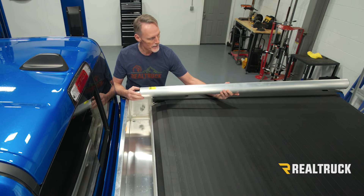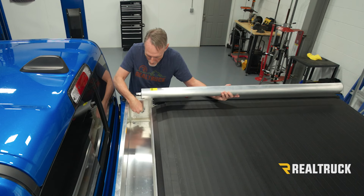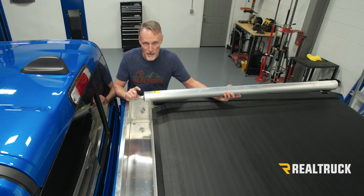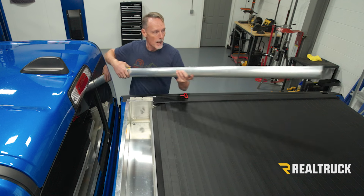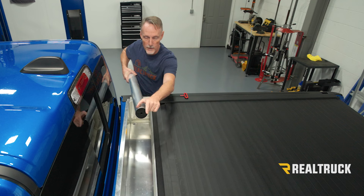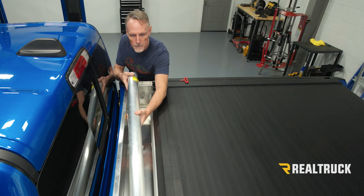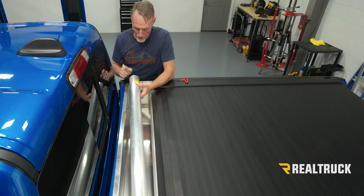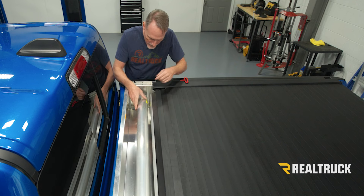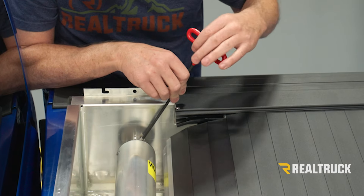Now here's our new spring reel. On this side is the stem that goes on the passenger side — it's going to slide right into this area. I've put a little X mark on that portion of the stem, and we'll show you why in a moment. On this side over here is the driver's side portion — you'll notice there's a hole that slides right onto the peg on the driver's side. We're going to line this up, insert it onto the peg, then line up our stem and drop it in place. Then we can take our bolt and go back through the stem.